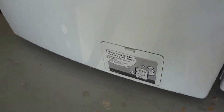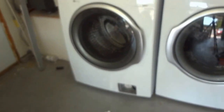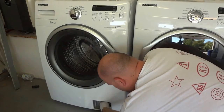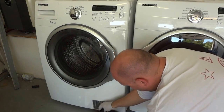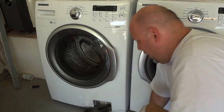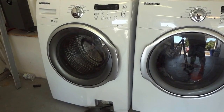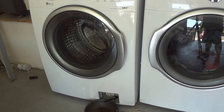The first thing we need to do is down here — there's a clean-out port. It says right here that you need to clean it out every two months, and the reason is that there is water left in the tub after every single wash, so it never actually fully empties. We need to go in here and pull this little tube out, get a container, and let that nasty water drain out. It'll take a while for all the water to drain, and then I'll show you something else that needs to be done in there as well.